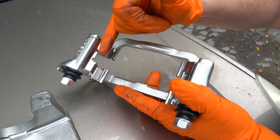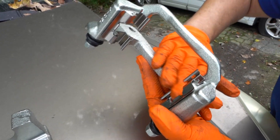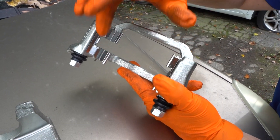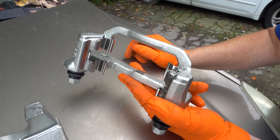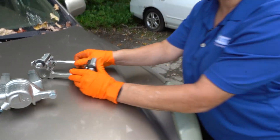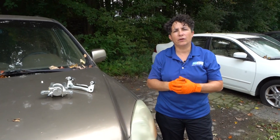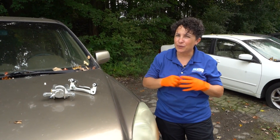If there's rust coming out of where the vents are on the rotor, it can hit on the rotor surface right in that area — that's probably the scraping noise you hear. Take the wheel off, support it well with a jack stand, put the car in neutral, spin the wheel, and chip away that rust with a small hammer. But if the rotors are too rusted on the surface, you need new rotors and pads. Without really seeing it in person, I can't answer it 100%.